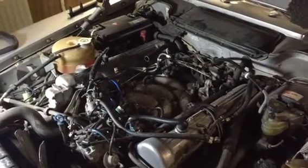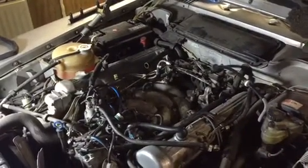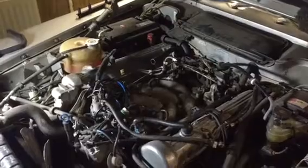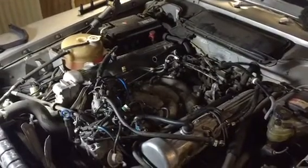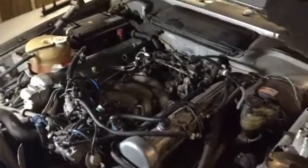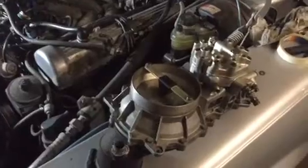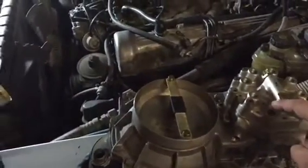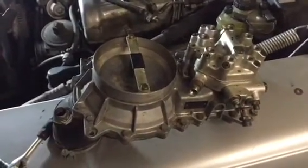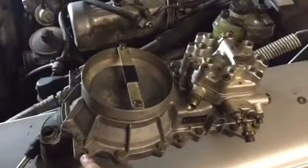I've been asked questions in the comments, and to have a good basis you need a good vacuum system. So I've dedicated this film to the Mercedes vacuum system. As you can see here on the engine, I've removed the SIS fuel unit. I removed it by taking off the fuel lines and supply lines — other than that it's a fairly easy job; there are four 10-millimeter screws attached on either side.